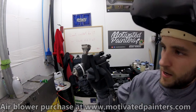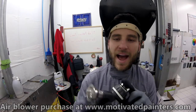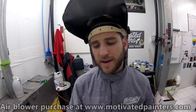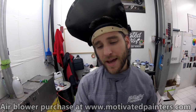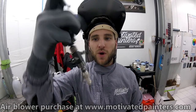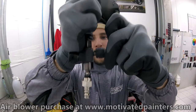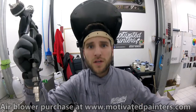I'm going to be using my Wacom HD Clear. Now, I had a 1.3 initially with this clear coat gun, and I didn't like it, so that's why you never saw it in a video. Now I have a 1.2 setup: 1.2 cap, the needle, the fluid tip, and everything. And I'm really liking this. It's really good. When I put it in the gun wash, I detach it, and when I take it out, I attach it back on. Super easy to take off. You just pull back and it comes off, then push it in, pull back, take off, push it in.